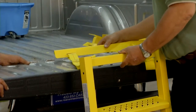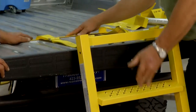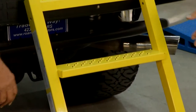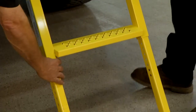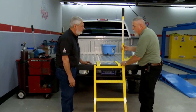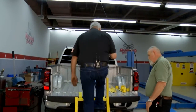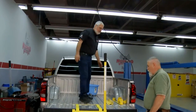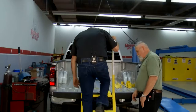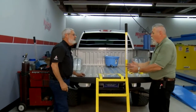Tailgate Master has a whole assortment of steps — one-step, two-step, three-step, and four-step models. This particular model has two pins; you drill two holes in the bottom of the tailgate and they also act as drain holes. The step clips right in, you pull it out with torque on the straps, set the step down, and adjust the leg so the tread is flat. It comes with a handle and you can put handles on the right or left side, or both. The straps are rated for 10,000 pounds and guaranteed for life. The placard recommends you face the truck when getting in and out so you can see your feet.